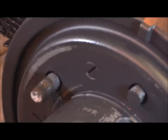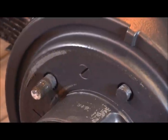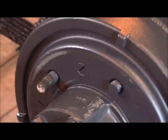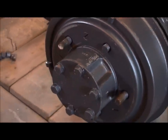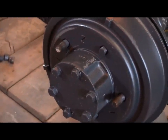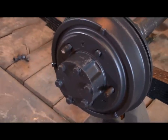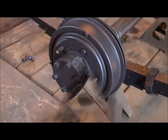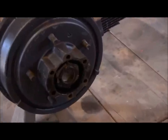After 50 years of rusting and being in that drum, those flat-head screws are usually quite difficult to get out. So what we're going to do is pull the hub assembly itself and do that on the workbench rather than trying to do it here on the trailer. We'll pull the cap and pull the wheel bearings, take the entire hub over to the workbench, and work on getting those screws out there.